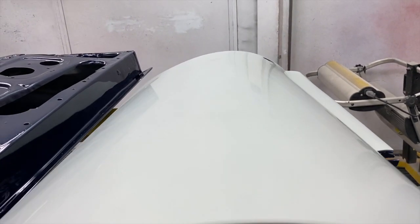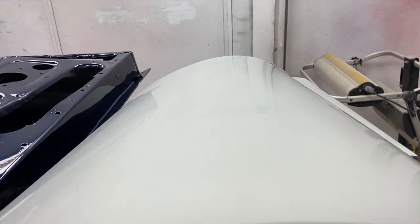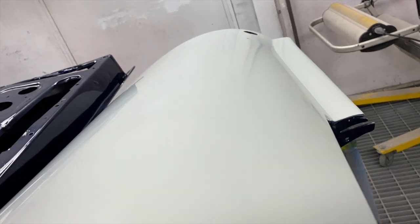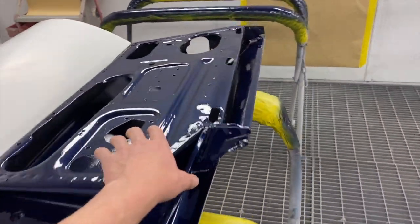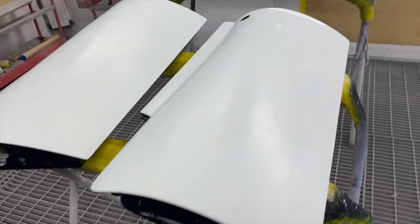the doors. So they've been 600 and 1200 on the doors. So you can almost see the primer just sort of starting to get a shine. You can see how smooth it is, but still keyed up enough for the paint to adhere to it. We'll finish wet flatting it and then get it all masked and in the booth, ready for the colour.